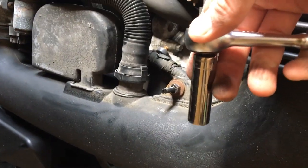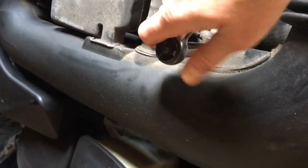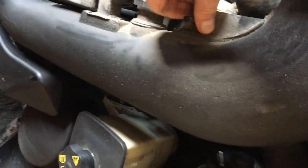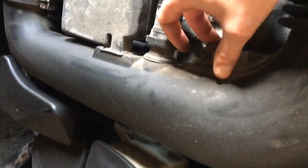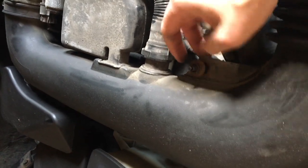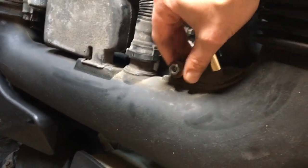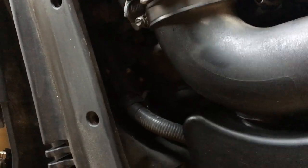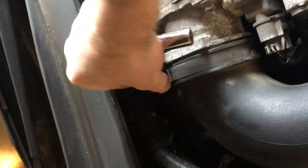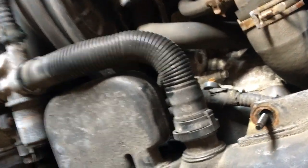This one I'm going to take the bolt off. Again I'm using a quarter-inch drive — this is an 11 millimeter deep well socket. Take off the nut — it's got an attached washer. When you take this thing off you're going to lift up because that stud is down below. Also don't forget there's another aviator clip over here — I've already loosened that with a screwdriver nice and loose.